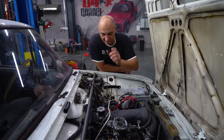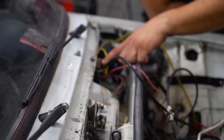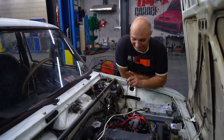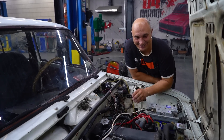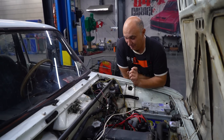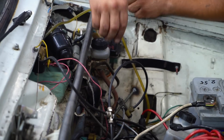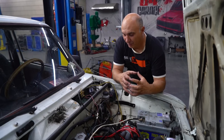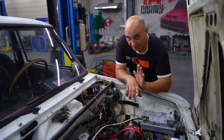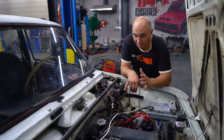So we've got a compressor in the cabin, and here you'll see a few lovely air tubes. Air is routed to the fronts and to the rears via this splitter. And this is a relief valve to release the pressure when you ease off the brake pedal. Another thing that took us a bit of time to figure out is the pressure regulator — that's the device that allows you to adjust the pressure inside the system. We took an old-fashioned oxygen regulator, a rather massive one, removed the screw that adjusts the pressure, then fitted a rod and connected it to the brake pedal. So now the harder you press it, the higher the pressure in the system — the regulator has two chambers and equalizes the pressure.